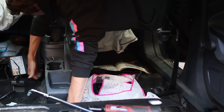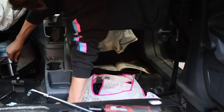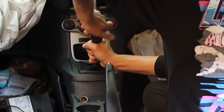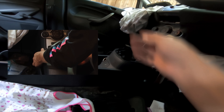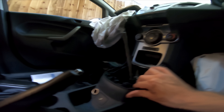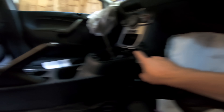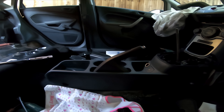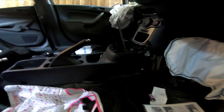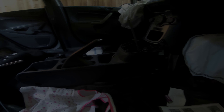First pull this cover off here, take the two screws out either side, then unscrew the gear knob and pull this fascia off. We've got two bolts here — only one per side so it's been off before. Take them off and this whole unit should come off, which should hopefully be enough to get the carpet out. To be honest, you don't even need to take it out but it's going to come out for the dash swap anyway, so progress — let's go!